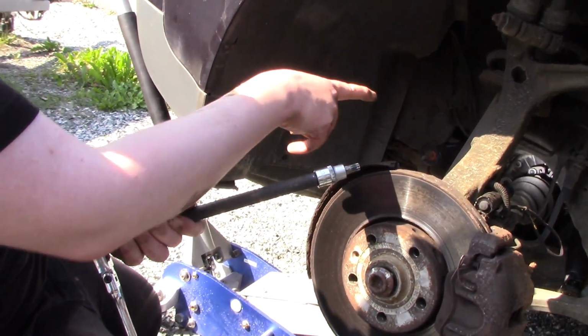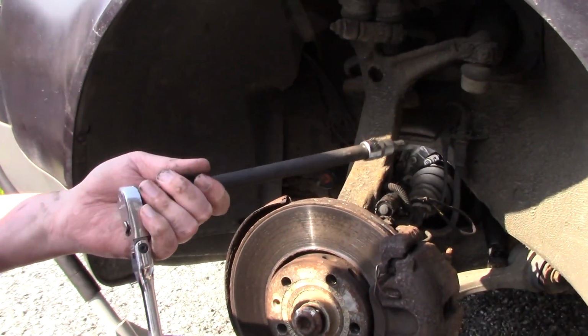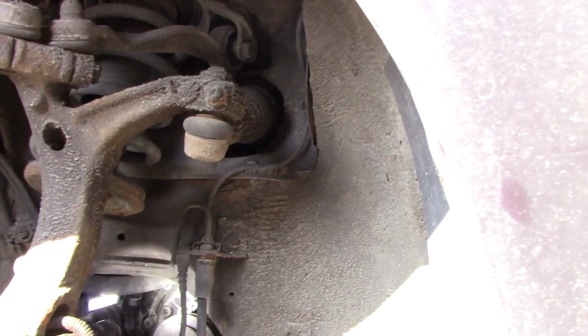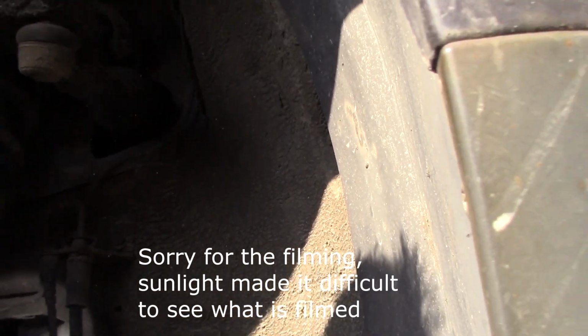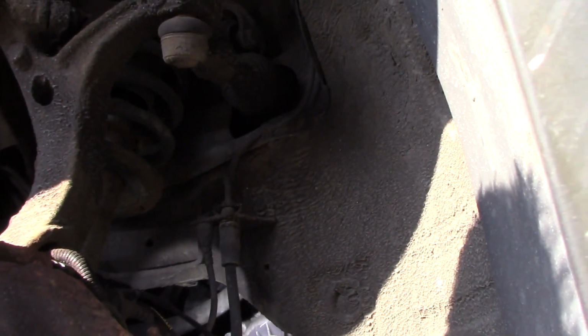Here's the inside there. There are triple square 10mm bolts. So I'm gonna use this device to remove them, and I think there are six of them. So I can show how I remove one. And then I can use the electrical ratchet to remove it all the way. Like that. And then there are 5 more.